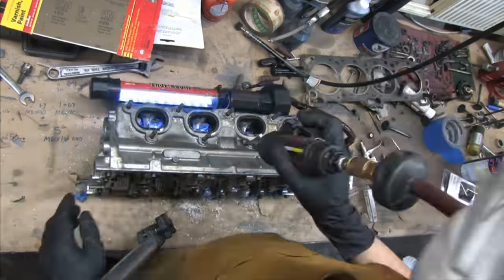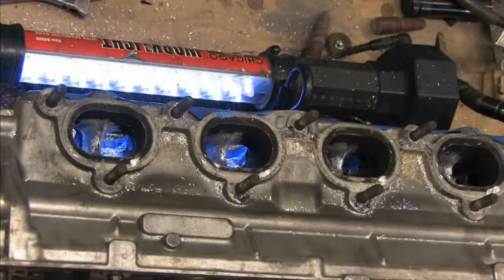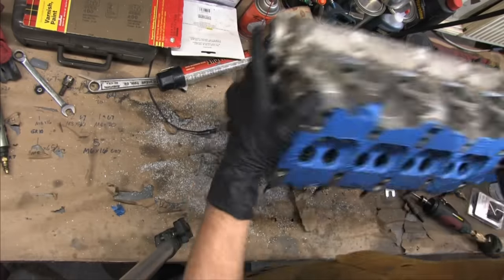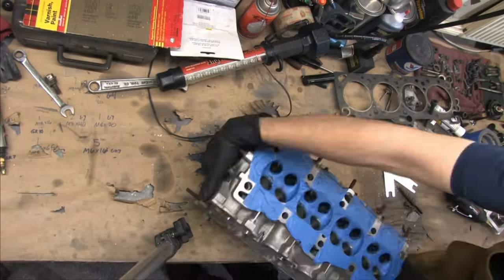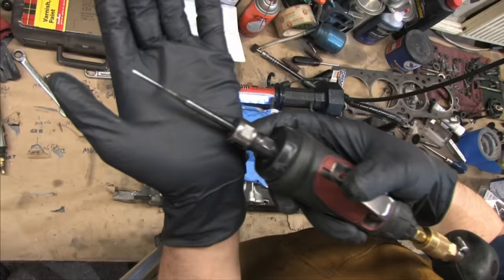Next, I flip the head around facing the other way so I can ensure that I have the divider even from top to bottom. That's all I'm doing with the carbides. I'll blend it larger with the sanding rolls, but I just want to make a low pressure zone further down the port to help pull exhaust gases through the bowls. Now it's time to blend the seats of the exhaust ports, grind the casting lines, and deburr the bowls.